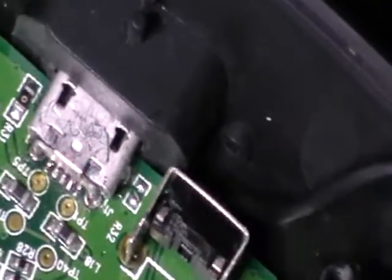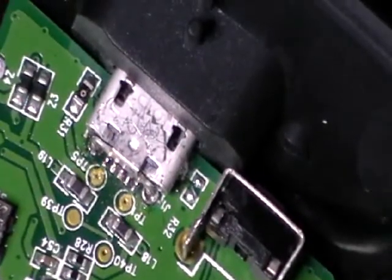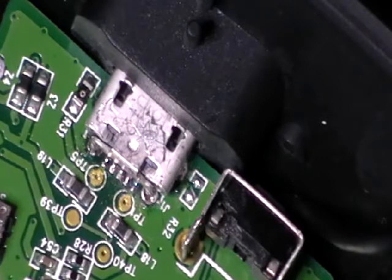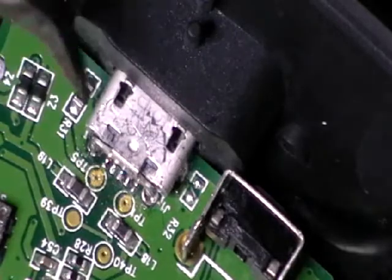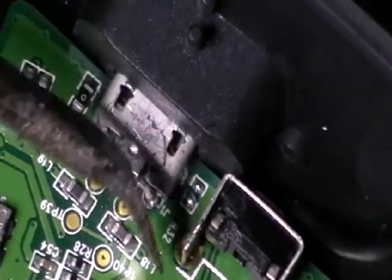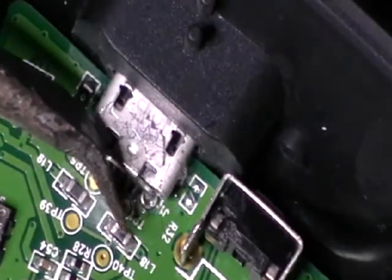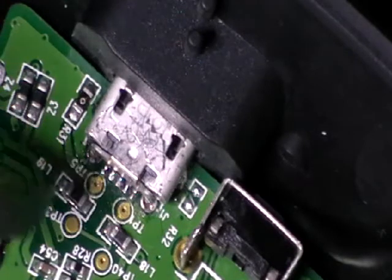Now I've pulled it apart a lot, but you really don't need to go any further than that, because that usually displays the micro USB port in there, which is soldered in four places — two on each side, two at each end — and five little lanes in there that supply the data and power connections.